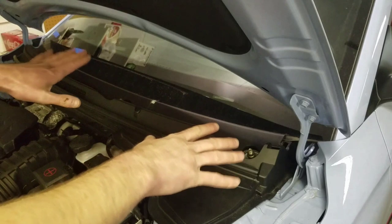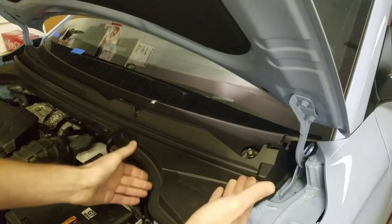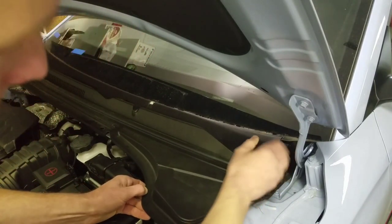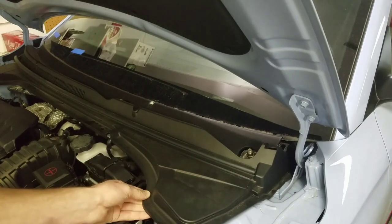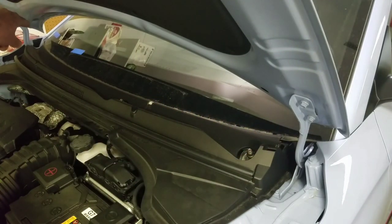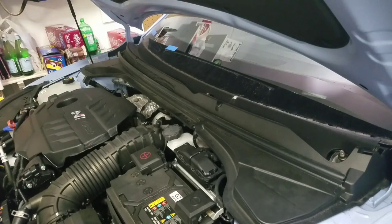Alright, we have everything removed. Now we can go ahead and take this whole piece up and out, but we're gonna have to disconnect the windshield wiper hose that goes to your sprayers. What you're gonna want to do is take your left hand and lift up a little bit. We have to pry this away from the windshield while pulling - pull with your left hand up and toward the bumper, while your right hand is jiggling the seal up here. As you can see it's starting to separate. We'll go over here to the other side and do the same thing. In opposite - you're gonna pull up and pull out with your right hand while your left hand gets that undone from the left side.